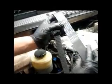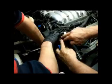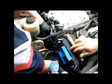Alright, as we advised the tensioner was bad, so now we have a new Kia tensioner. As I said, it comes with this ring. So we're going to get back to the timing belt here. They are directional so you have to put it in a certain way — it goes this way, there's a little arrow on there. Now the cam tools will lock down the cams. And just a little hint to make your life a little easier: once you put the belt around the cogged gear, you can clamp a little paper clip-type clamp on there.